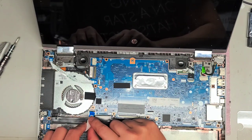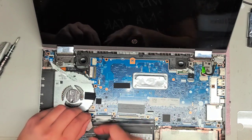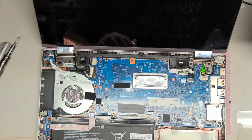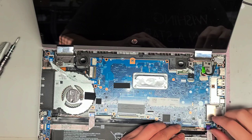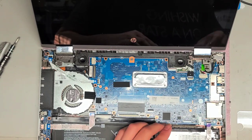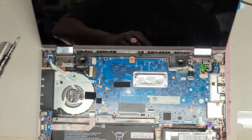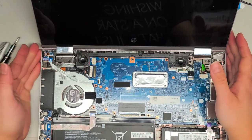I'm not even going to put back the hard drive — actually, I do have to put back the hard drive because they're using an SSD for the boot, so if I leave that disconnected it might mess up the boot. Make sure you reconnect these. The battery — you don't have to remove that when you're taking out the hard drive. We're going to put the hard drive back in. Put that connector in there, put that latch down, drop the hard drive back in place. It has those little rubber tabs — make sure they go in as well.